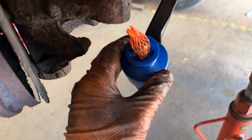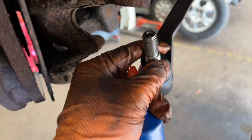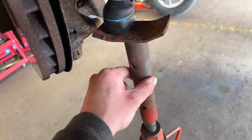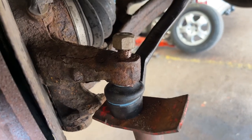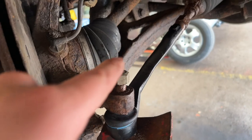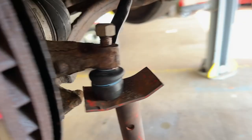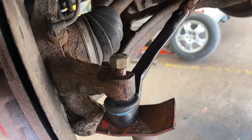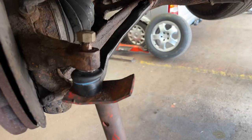Now I'll tighten that up and pop it into position. Take off the protection, get some copper grease on the threads and the little seat area so it doesn't get stuck. That's it in place. I'll use the transmission jack — put a bit of weight on it, jack the arm up a little. Don't use the impact gun on these. It's a 21mm — get a spanner and a Torx that goes through the top. Tighten it up, then come along and nip up the 22mm locknut. Reverse of slack, then off — job done.